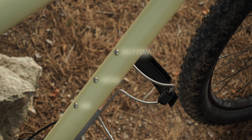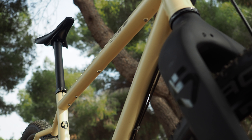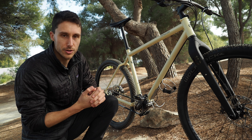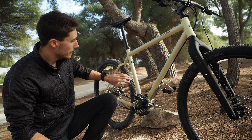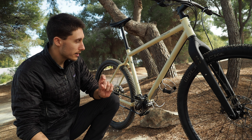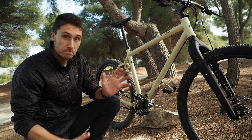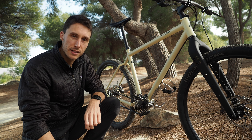The bolts that come pre-installed on the Outback frame are button head M5 size bolts, used mostly for aesthetical reasons. I prefer socket cap bolts in M5 size because the Allen key sits a little deeper in them and I find them more functional. I'm going to install a mount here for our cooking alcohol bottle using socket cap bolts. The button heads are perfectly functional but a little on the short side, so depending on what you're installing, you may need longer bolts.